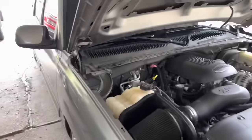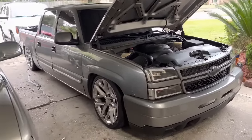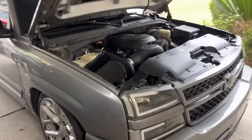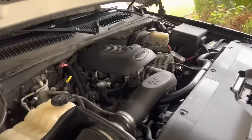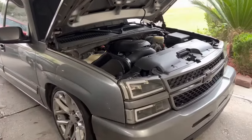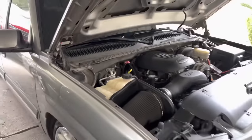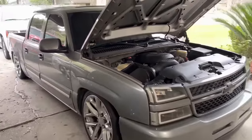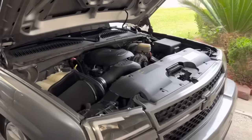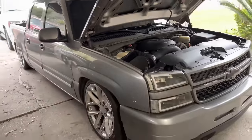These trucks come with a 4L60E transmission and they're horrible — they're trash. After camming, if you want to do performance work, they're just not good. Even on a completely stock truck, if you dog it a lot, do burnouts and racing, it's going to go out eventually. I had a 4L60E and it went out on me twice. The first time was because I used to swing this truck a lot and do burnouts and racing.